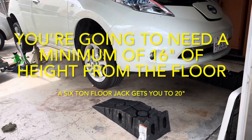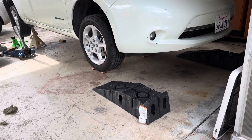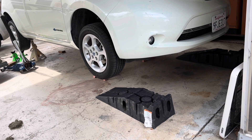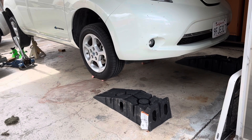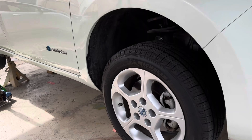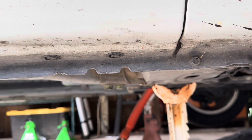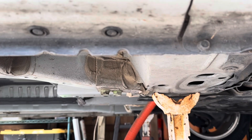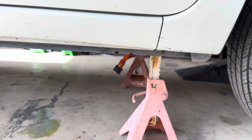In raising the car up — this was my first time doing it — I first drove up on these ramps, which gave me about nine inches of height simultaneously on the left and right side. Once I did that, I could get my floor jack under here. You see that depression is the jacking point. I put a piece of 2x4 on the other side of that lip with the two indentations, and I could jack up from there without damaging the car.